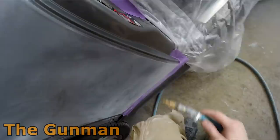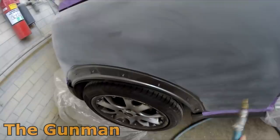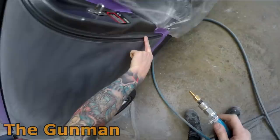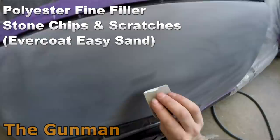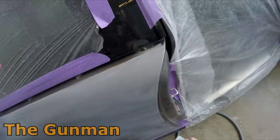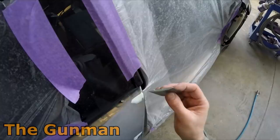What I'm doing here is finding those stone chips — there are a few stone chips and scratches in this blend panel — and I always fix them. You don't want to paint over chips and scratches if you don't have to. Some people do it, but it makes you wonder how much respect for the vehicle you have. Within reason, if it's on a blend panel and you need to keep the color small, I'll clear over it if I have to.